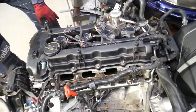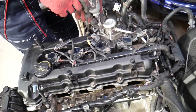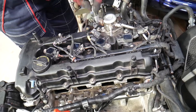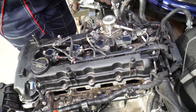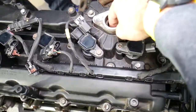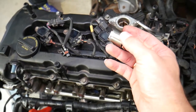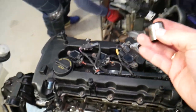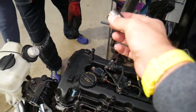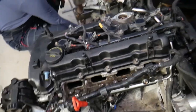The fuel line came out. Now let's go ahead and remove the high pressure fuel pump. Right here is the camshaft follower, also known as a cam bucket or camshaft tappet. I recommend inspecting and replacing those because they do fail sometimes and can destroy your engine.